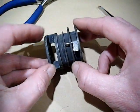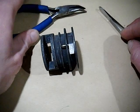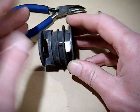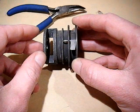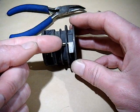Now what you need to do is have on hand a pair of tweezers or narrow nose pliers, whatever works best for you. Place it down on the bench with the pawl to the right and the planet slot to the left, and push this pin half way out.